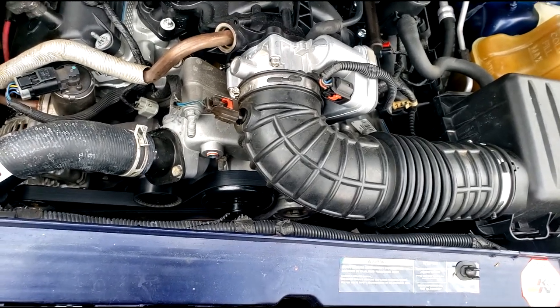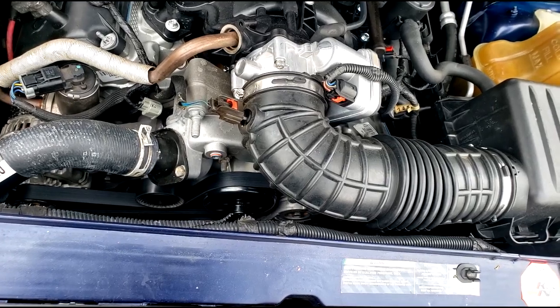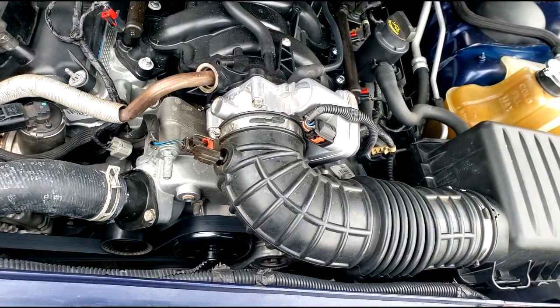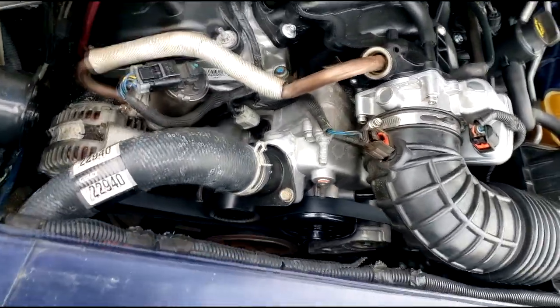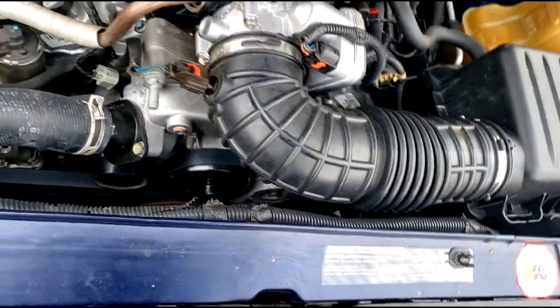So if he just had this done and this shop could not complete the task, it was wise and smart to bring it to me. That even looks like a new throttle body, but I didn't have to relearn ETC, just relearn cam and crank. So yes, guys, this is highly recommended. In fact, that could be a whole new engine, a whole new block motor, long block.